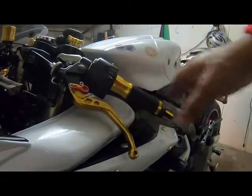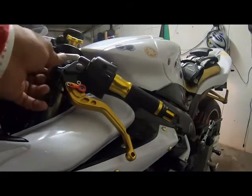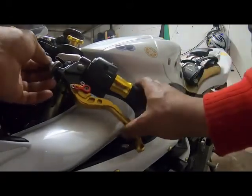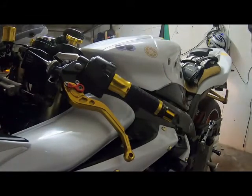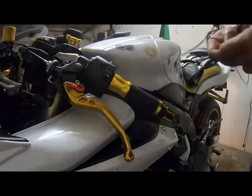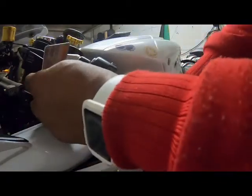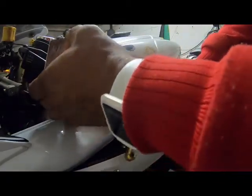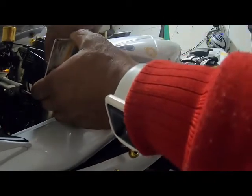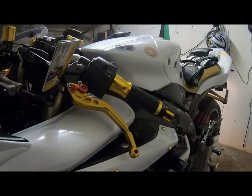Now it's finished, it's inside. So I'm just gonna back this off a bit. I'm gonna get a bank card or something, some ID. When you're adjusting the brake, the clutch, you should have at least 2 ID space in between. So I'm going to go on the next side, adjust the next side, then I'll come at the top, then I'll adjust this side.